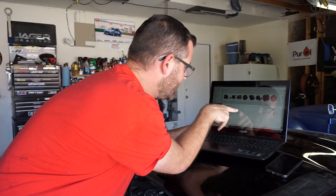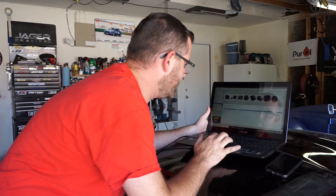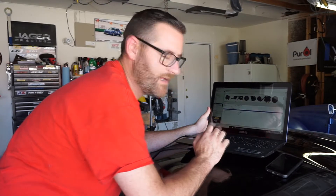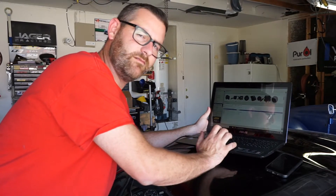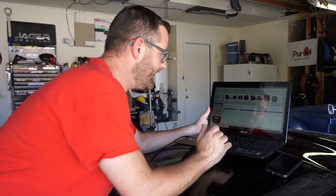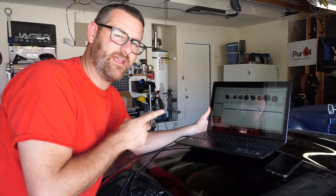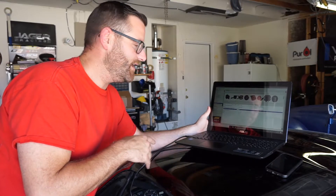Now I can see I have an oil pressure gauge, water temperature, and my AFR — all of these are now reading. With the scalars, it's in Celsius, so eventually we'll go in and change things so they read how we want in AEM data. Quick and pretty easy, as long as you have the right tools for the job. I'm able to log all these multiple items, and I'm also going to add one more thing later — RPMs out of the tach — which will be done via an analog channel, slightly different but still pretty easy.